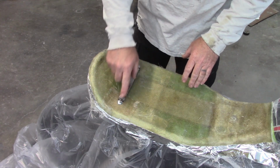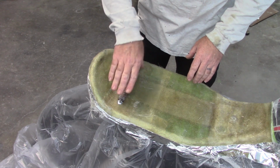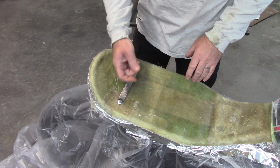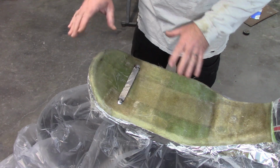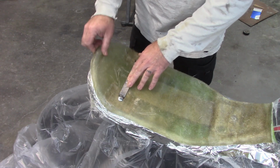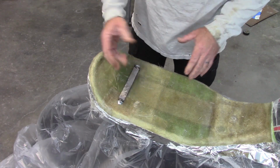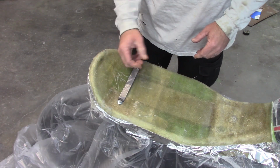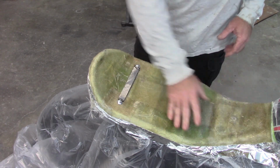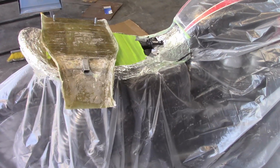So I decided to go between the 2 bolts. I cut the end slightly, like a half moon, put it between there, and I did have the bolts tight, had nuts on the backside holding these down tight. I've taken those off, and now if I hold this in place, no problem. So the next thing I'll need to do, again, I'll put the nuts back on these, hold them down, and get resin on this and another layer or 2 of fiberglass.